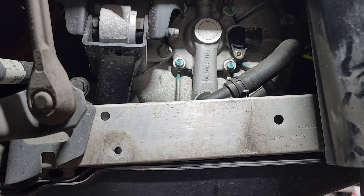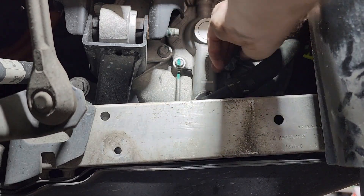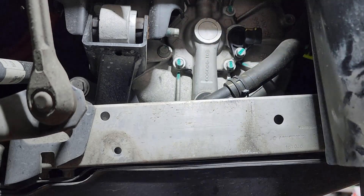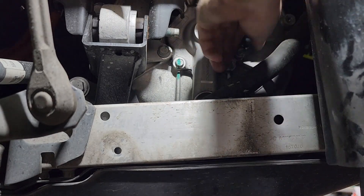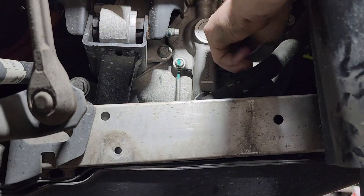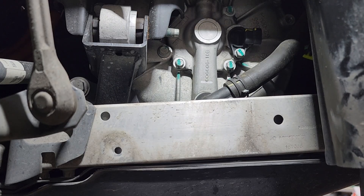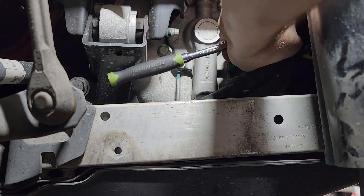As I'm putting this together, I realized I didn't include a very good explanation of where the coolant is actually coming from. The coolant you're seeing on the speed sensor is leaking from a seal that's in this aluminum housing — you can see this round protrusion here on the housing. There's a seal in there that rides on the rotor shaft, and that's what's leaking. The sensor just happens to be right next to the seal, so if the seal is leaking you're going to end up with coolant on the sensor. It's just super prevalent on these motors, and there's not really much avoiding it — it's just a matter of catching it early.